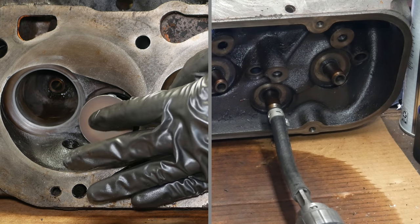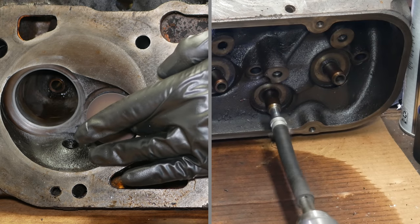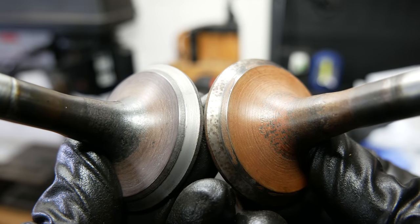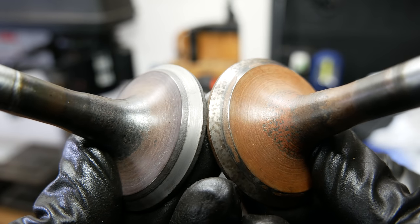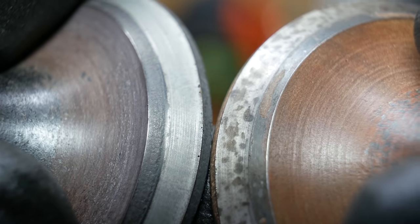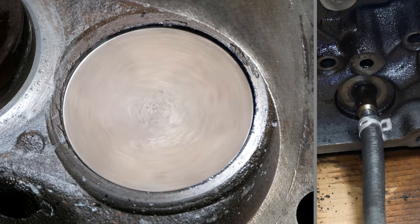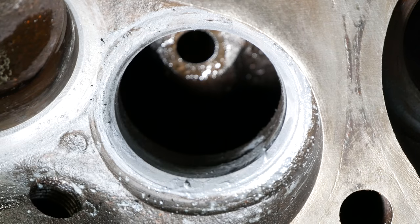We'll switch to the exhaust valve for that same cylinder and repeat the process. It took over 10 minutes of grinding to get that first intake valve looking good, but the exhaust valve only took about two. The comparison between the valve we were just working on and one we haven't gotten to yet is pretty stark. This smooth, dull gray surface is what we're looking for on every single valve face and seat. It's not going to be totally perfect — nothing in this engine really is — but it is a huge improvement. When the valve is closed, it should be sealing all the way around its perimeter. The angle and position of each valve's face should match exactly to its seat in the cylinder head. At this point, it is especially crucial that we don't mix these up. That abrasive valve grinding compound really does get everywhere, which is why we want to do this before a final cleaning of the cylinder heads.